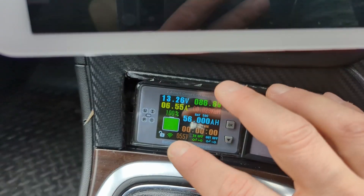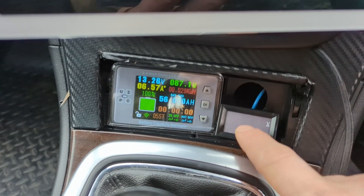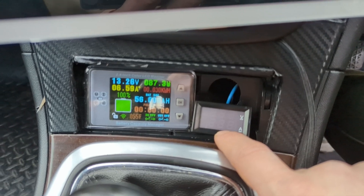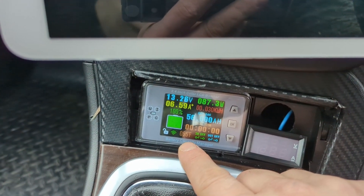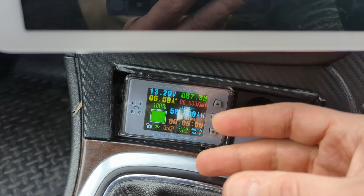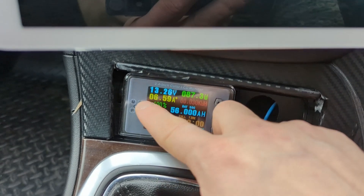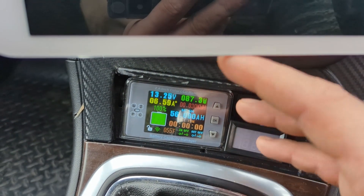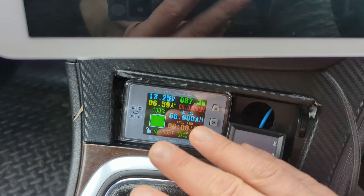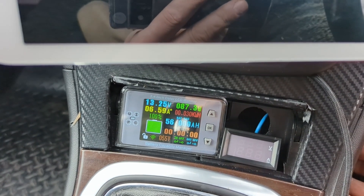This little meter shows a lot — about 86 watts just on standby with nothing playing, six and a half amps. The really great thing about it is the refresh rate. Other meters refresh twice per second — about 2 fps — but this one refreshes 20 times per second, so I can monitor voltage and amperage almost in real time. It also has a graph function you can use connected to a laptop. It's a very cool meter, about 28–30 pounds with shipping, and does literally everything for monitoring your battery.